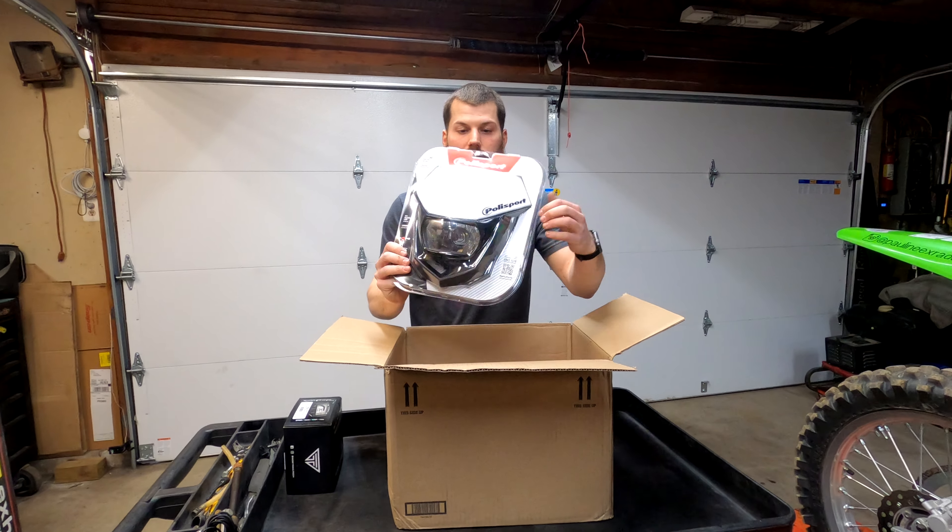Going with the enduro route, we did go with the Polysport Halo light. This is not the LED version — it's a straight H4 bulb, 35 watt, with a little LED running light kind of like a city light. We're going to see how to wire that up; this comes with everything you need. The back shows a wiring diagram and it comes with extensions, so if you want to mount it a little further away — which we're going to have to do to tuck the wiring — you can. It's pretty plug and play. We're going with black and white, kind of fading more into the black style for the bike.